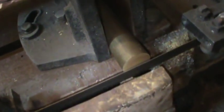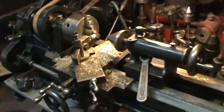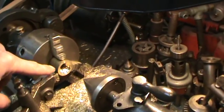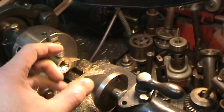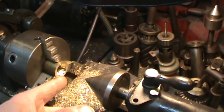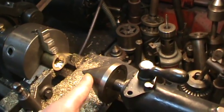I went back to the father-in-law's a couple weeks ago and grabbed a bunch of metal stock, including a long rod of brass. I cut off about a four-inch piece and stuck it in the lathe to get some time figuring out how stuff works. I drilled a half-inch pilot hole all the way through the whole piece, which allowed me to support the four inches of it, then I took a cutting tool and cut the outside down to diameter.